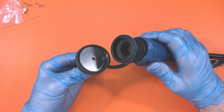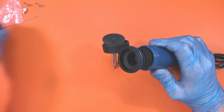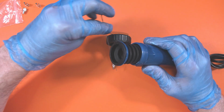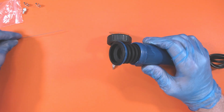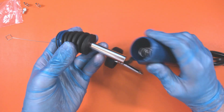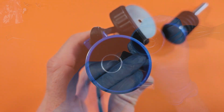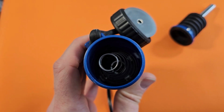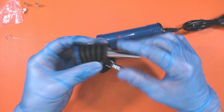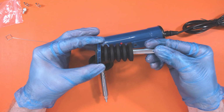Okay. So it's not like a normal, regular solder sucker. You have a kind of metal rod that sticks through and goes all the way down into it, and then when it sucks, it brings up the solder and sucks everything up with it. Oh, okay, so it's just a magnet. So it's a magnetic coil inside here, and every time you press this button, it will activate the magnetic coil, which will in turn move from this position to that position.